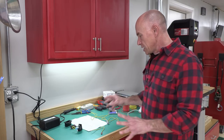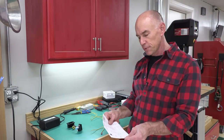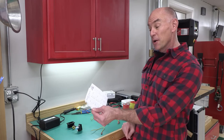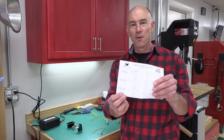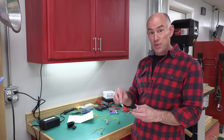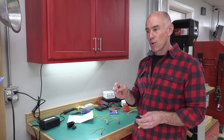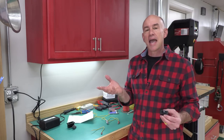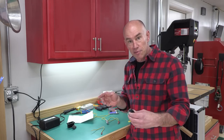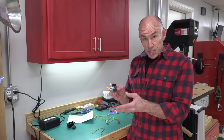And then finally, we need the switch itself. Now this came in three parts. First, the switch itself is V4D1-A60B. Basically, it's the SPDT on-on switch with an independent light input. Now the independent light input is kind of important. You would normally use that in a dash, where when you turn the vehicle lights on, you want your dash lights to come on so you can see the lighted switch. You might use it for that. So the light is independent of the switching here.